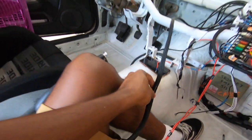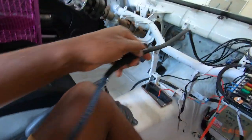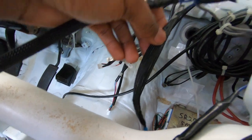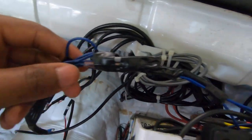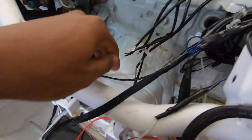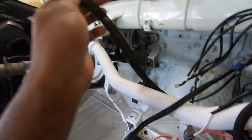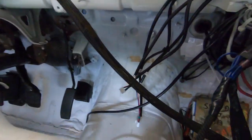I'm making decent progress right now. I threaded them all the way down so the entire tach harness is loomed, and even the ground wire has loom on it. I just taped up the loose wires so they're not hanging everywhere. The stoplight harness — the brake light harness — I loomed that as well and that looks really clean.